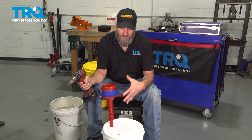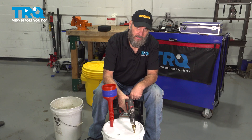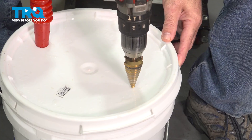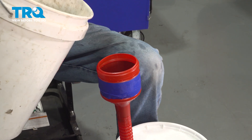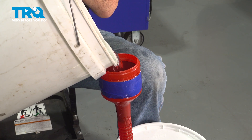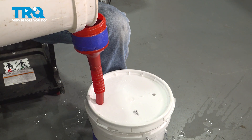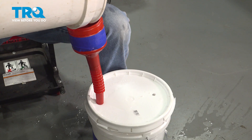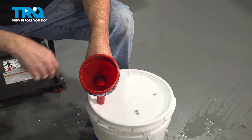As you can see, the water had a lot of difficulty getting into the bucket. Now I'm going to drill a hole on this side of the lid and that will allow the air in here to escape as I pour the liquid in, and we'll see the difference. Now, with the vent hole — as you saw, all of that water went directly in without incident.